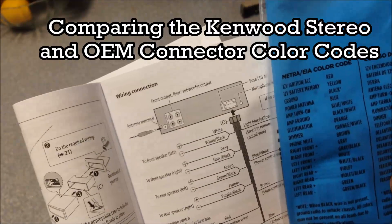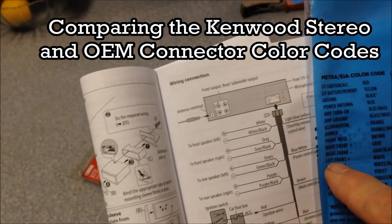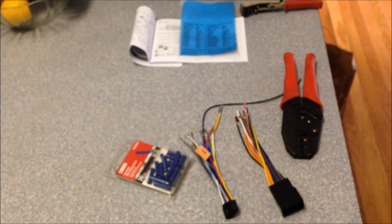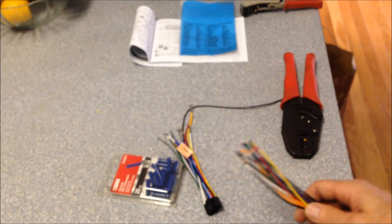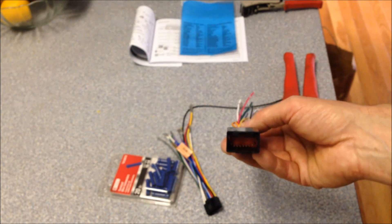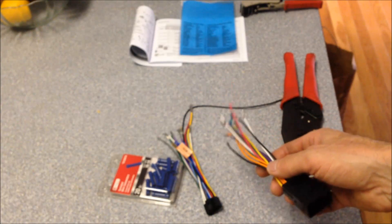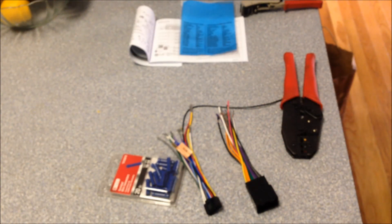I'm getting ready to wire up the connectors, and everything pretty much matches up here. For the left front speaker, that's white over here — and front left speaker is white on the other side too. Just follow this match-to-match on the wires. What I have is a set of crimp connectors. I've already stripped the wires on the stereo connector, and the OEM connector already has a pre-strip — you just have to pull it off. Double-check and make sure this fits your OEM connector before you get started crimping; it would be a bummer if this thing couldn't get plugged in after you got all done.